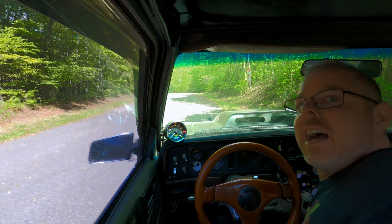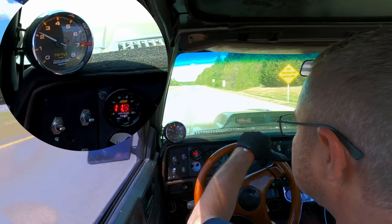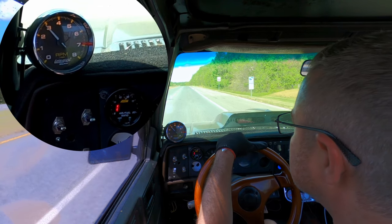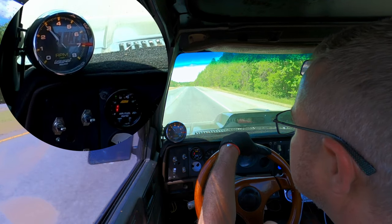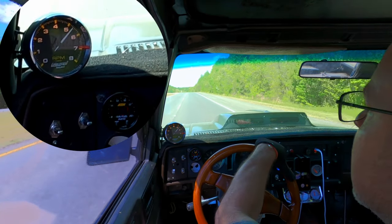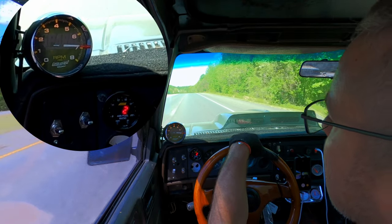Lost a little bit of traction there. I didn't even try to get first gear because that was gonna be ridiculous. All right, look at these plugs. All right, let's talk about this full rip. I started out in second gear and I tried to put it under the longest load as I possibly could. So I'm gonna stab at it, you'll watch. It'll go fat for a quick second, but that was all accelerator pump that's doing that. Had to pedal it, see, I pedal it, little fat, in the 10s, back to 12s, we pull it through, 12, 12.2, then a shift.